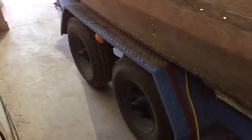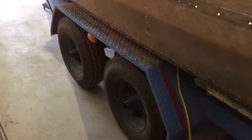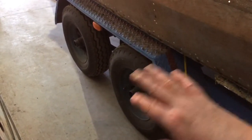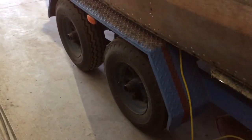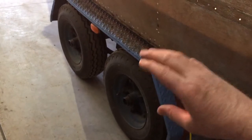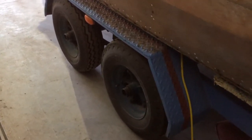I picked this boat up on a Friday morning and drove it right from the original owner's house to Les Schwab Tire in Coeur d'Alene to have them inspect the trailer. Two of the tires were from 2012 and in good shape; the other two had to be replaced. Luckily they had the exact same tires, so now I have four good tires on it. I also had them replace all four wheel bearings, so I didn't leave Coeur d'Alene until Monday afternoon. This summer I also want to pull the tires and wheel bearings again and replace the hydraulic brakes — I'm not even sure they work at all right now.